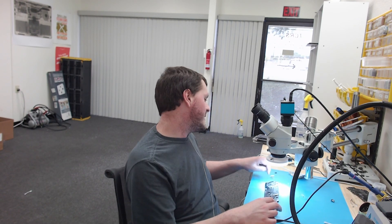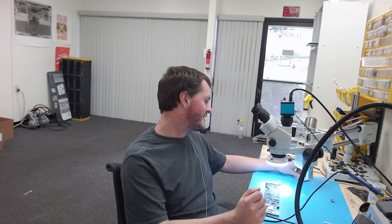It's really, really important when you get boards that randomly stop turning on to just look at them really thoroughly, because if we looked at this board it looked pretty good. That clock chip looked fine — it was just that little bit of corrosion that we could barely see. Visual inspection is very, very important when it comes to board repair in general. You need to have a really good trained eye to catch some of these faults.